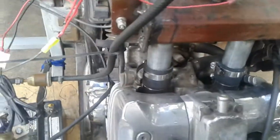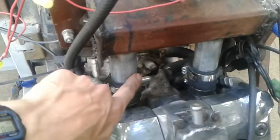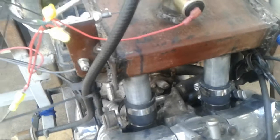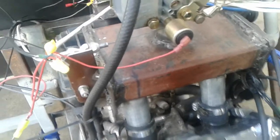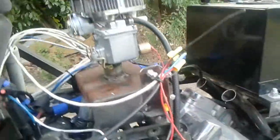I figured out the right size pipe to use and the best way to connect everything — just with radiator hose on both the motorcycle engine side and the four-to-one intake side. I had to reweld it, fill it with water, test it, and retest it a bunch of times just to make sure there were no leaks. To this day there are probably one or two really small leaks on one of my welds.